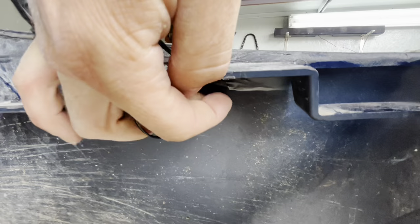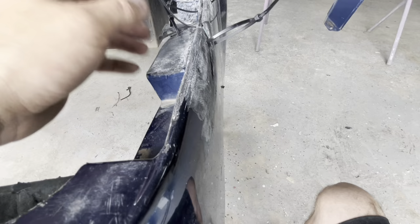The way this is actually torn is pretty unique. You can see it split the plastic in half — it's not split all the way through, it's created a pocket. It's dark right down in there because the plastic actually split in half through its thickness, forming a sleeve that we've got to get filler down into. There's really no way to scab the backside of this one.